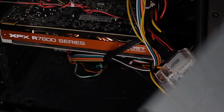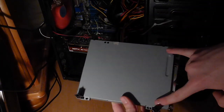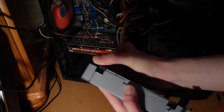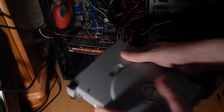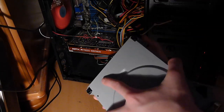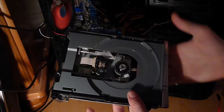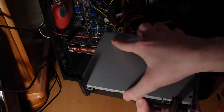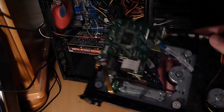Now for the drive itself — here's the DVD drive and you're going to want to undo the screws, then pull it open. There should also be a warranty sticker here; you're going to have to rip it or try and use a hair dryer to remove it carefully. Once you get the drive open, you're going to want to turn it upside down and remove the back plate as well, because you're going to need access to the PCB.